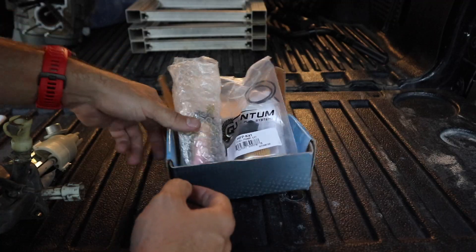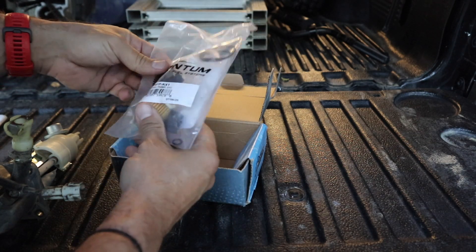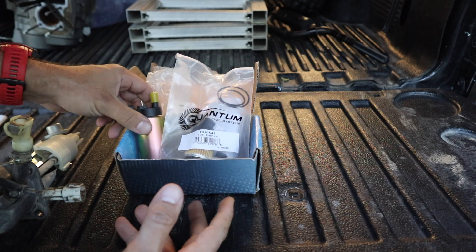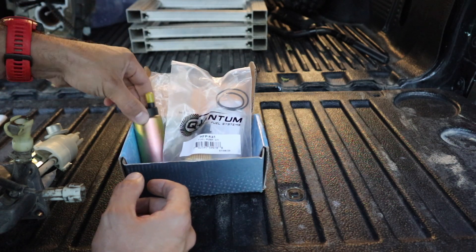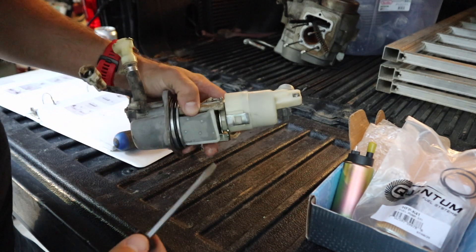I've already removed the fuel pump from my 990. As with the 1090s, 1190s, and 1290s, it's on the left hand side of the bike. I pulled the left hand tank off just to make it a little easier to get out, though if you pull the skid plate off I think you can get to it without removing the tank. It's four bolts to pull the fuel pump out. So let's head over to the tailgate workbench. Here's the Quantum fuel pump kit — the pump, gaskets, and filters. The 990, 1090, 1190, and 1290 all use the same fuel pump. I'm not sure on the 790s and 890s, so double check. I've linked the full kit, pump-only, and gasket/filter kit separately in the description.